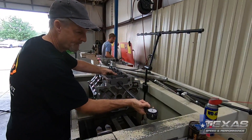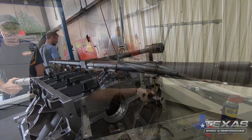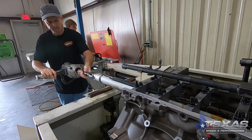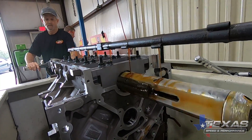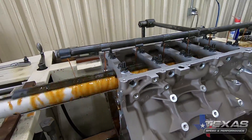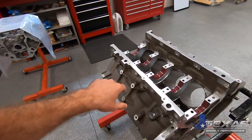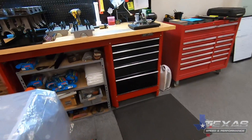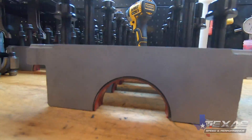Back at it this Monday morning working on Chris's engine, getting it done and to him quick. They told me it's just in the align hone so we're going to head over and check it out. The outside two are perfect, the inside three just needed a tiny speck, so they got it done. Now the block is all cleaned up from the line hone — looks like they got the bearings in it, all lubed up and ready for the Dart center-weighted crank, with all the main caps cleaned up and ready to go.